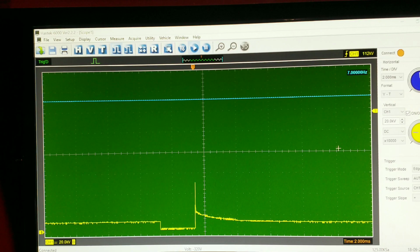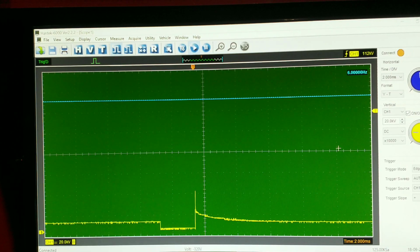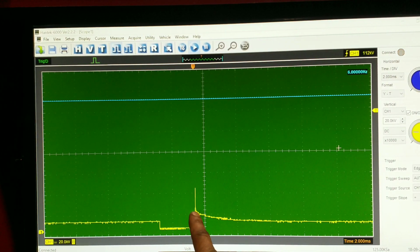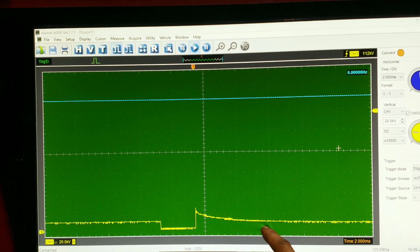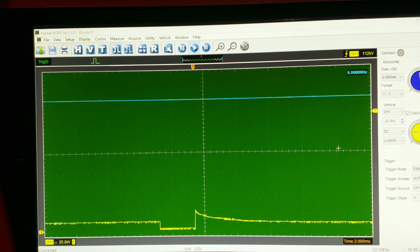On this picture you can see we got the 12 volt coming in. We got our ignition control pulling it to ground, so we know the computer is controlling this coil, and we get this large voltage spike that suggests this coil is making its magnetic field. But I don't like this line. See how this one just slopes down back to 12 volt again? I don't see any activity happening here. I don't like it, but I'm going to change my probe to a different cylinder wire now and see what it looks like.